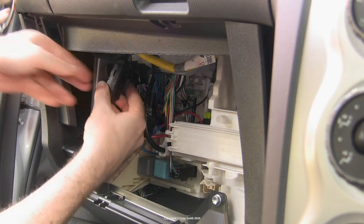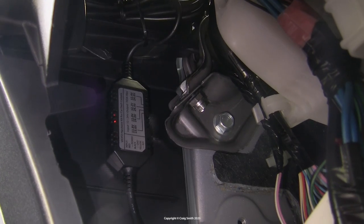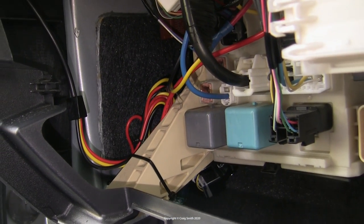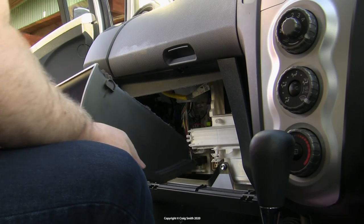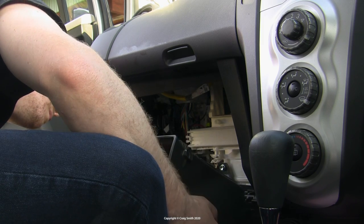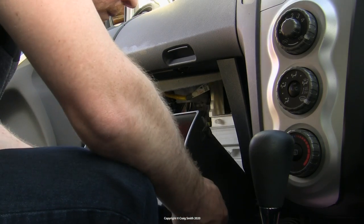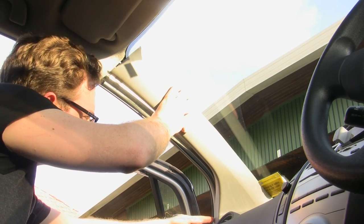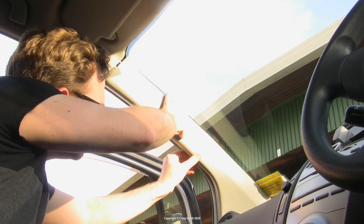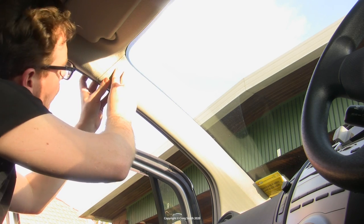Back to the fuse box. Now that the camera's in place I knew how much cable it required, so the excess could be pulled back inside the dashboard and the power supply needed to be securely tidied away. I used some double-sided tape to stick it on a frame to the side. This space on this right-hand drive car is the glove box area, so it needs to be out of the way of that. Then I cable tied all the excess wires in convenient places, all coiled up and placed neatly out of the way. With the glove box back in, that was all for the fuse box area, and the A-pillar cover goes back on just as easily as it came off — just make sure the seals around the outside edge are properly overlapping and the cable remains properly inside.